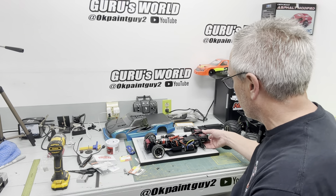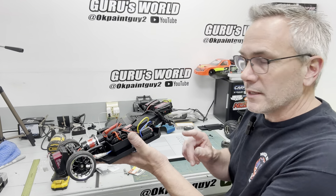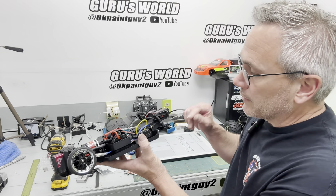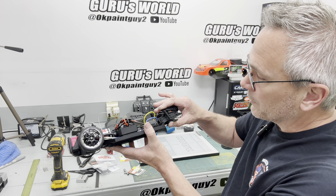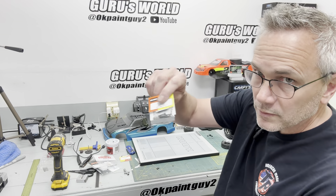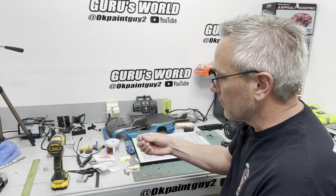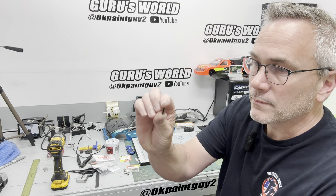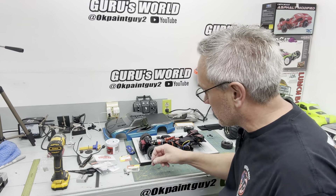Back in the studio tonight — Tuesday night — I got a microphone, hope it stays charged. First things first: we take the rear wheels off. I went ahead and took the drive pins out and put them safe so we won't lose them. Tonight we have to get the servo horn level. We're going to take the shock off, we need the car to be laid out low with the servo straight, so we're going to use our new Dubro ball ends. I'll probably have to cut them and connect those two together with these little 4-40 set screws. These long set screws come out of my pan car stuff — they're easier to manage because they've got a hex drive so you can run them up in the ball ends without having to fight it.